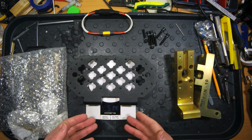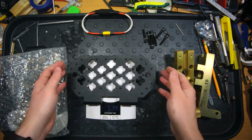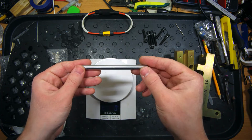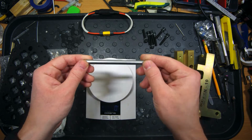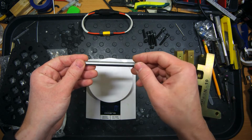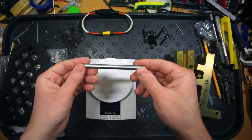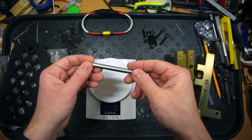The weight is 514 grams. This means that two pedals will give you about 1 kilogram, which is much better than Begode honeycombs. Also, the set of pedals includes these custom axles, so they are also reinforced and hardened. And you may be sure that they will not bend inside your pedal hanger, and you won't have any problems with your axle getting stuck inside the pedal hangers so that you can't disassemble your wheel.